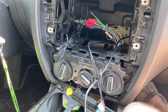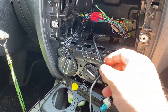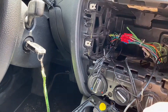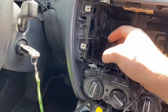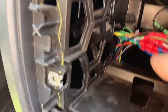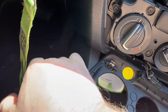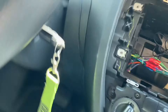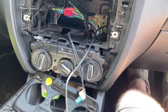With this Pioneer setup being Bluetooth, it's got a mic. I could have cheated the mic wire right through here and it would have worked fine, but I wanted a cleaner look. So I ran it through one of these holes — I believe it comes out down by the gas pedal — and then I pulled it up. I'll tighten it up once the radio is installed.